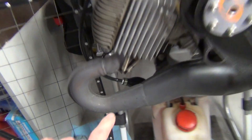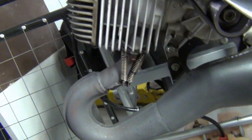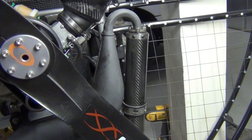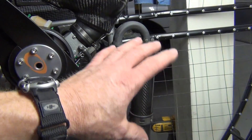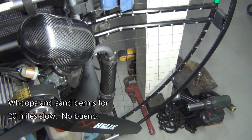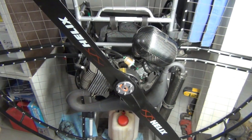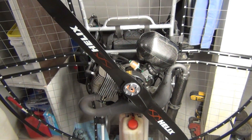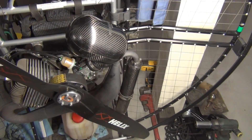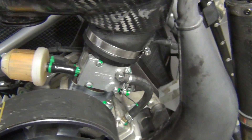The only thing I haven't done — I've replaced my springs recently, had one of them break on the hook part, so I just replaced all four and redid the cable. I need to do my silencer. I had a CR250R that had a problem with the silencer getting rotten or full of oil — it caused a blockage and a power loss, just went gutless on me down in Cherry Creek. I want to get this sorted out, especially because I'm running way too rich — still on the break-in cycle, too much oil. I just change the plugs more often, but this is where all that ends up and it's getting a lot of abuse. Look at that carburetor though — it looks amazing. It's spotless. I love it.